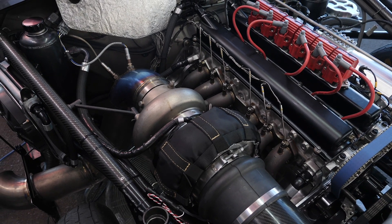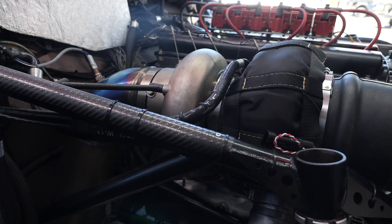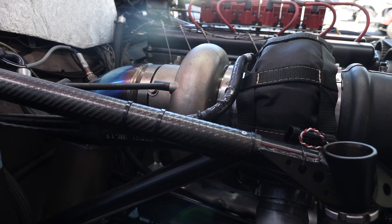What this drive-by-wire throttle body does is control a regulated leak, or boost leak if you like, and this is fed back to the intake side of the turbocharger. By opening the drive-by-wire throttle body, this leak becomes greater and the boost is reduced.